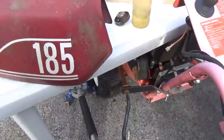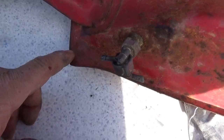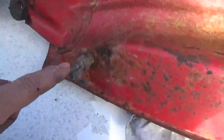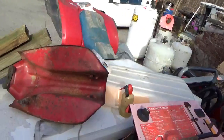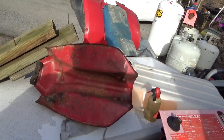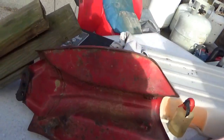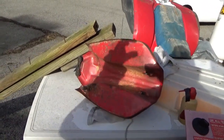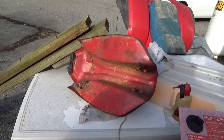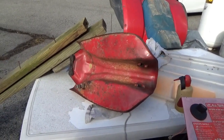I put a little bit of gas in the tank and sloshed it around. The tank doesn't look the healthiest in the world — I can't really find a spot that it rusted through, but trust me the gas will find it. I sloshed it around and I really don't see it leaking anywhere, except the turnoff valve leaks by — it was bubbling and you can see it's a little wet. The gas tank appears to be intact. I don't think I'll fill it with gas and come back a week later, because weather changes will pressurize and depressurize it and any weak spot on the bottom will let go.